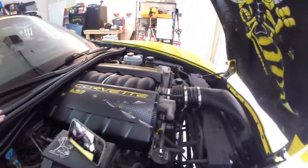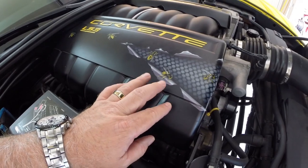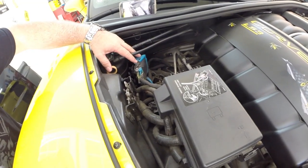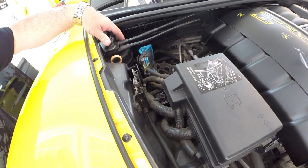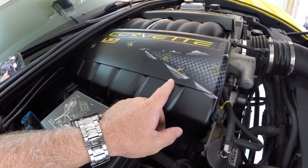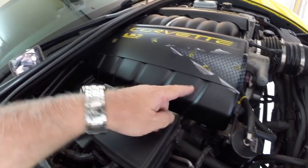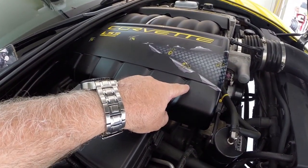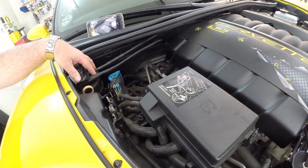On a non-dry sump car, right in here you'd have the oil fill cap — that's where you'd put the oil — and your battery would be over in the section where the dry sump tank is. Basically what they did with this car is they took the battery and put it back in the trunk area on the passenger side, then put the oil tank in here. You don't have an oil fill cap on the valve cover — that's the big difference between a dry sump and a wet sump car. On a wet sump you'd have the fill there and no external tank.